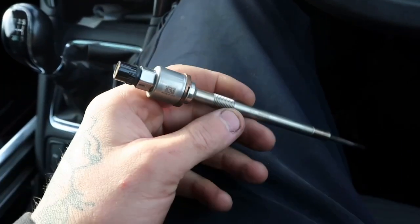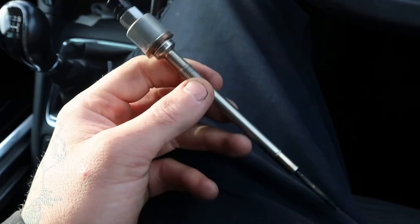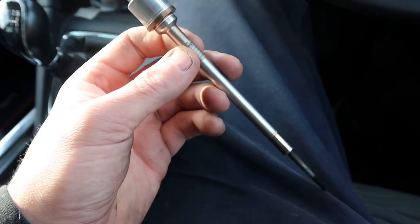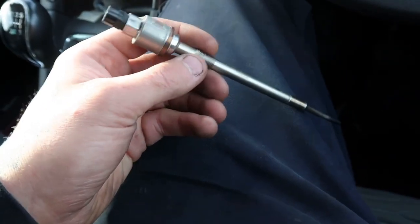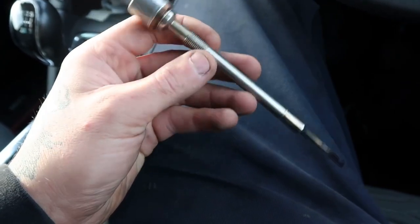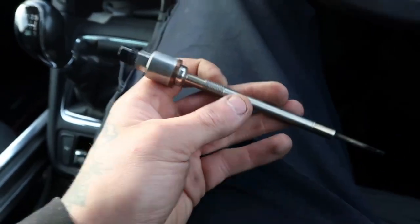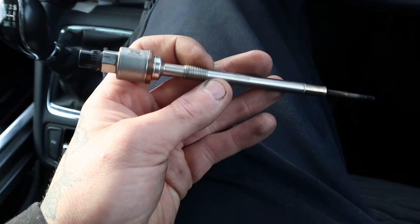This sort of glow plug I pulled out is what they call a pressure glow plug. There's no real efficient way to test it — I've never really tried to scope it, there's not much room in there. You also can't do an ohms check like you can on a normal glow plug. It's got two functions: as a normal glow plug it heats the cylinder for cold starts and during DPF regenerations, but it also has a piezoelectric sensor that measures the gas pressures in the chamber during combustion. It's a genuine Vauxhall part. Fits in nice and easy — no programmer needed. A nice straightforward job if you follow those tips of diagnosing the right cylinder and confirming you've fixed the problem. Thanks for watching.